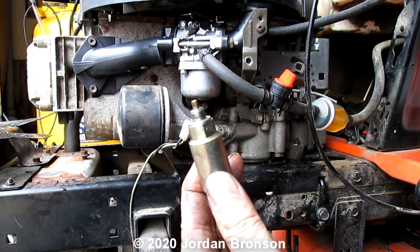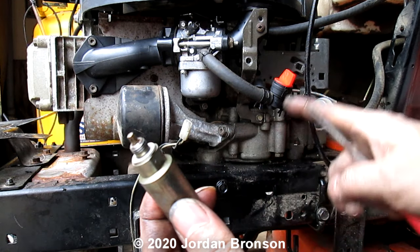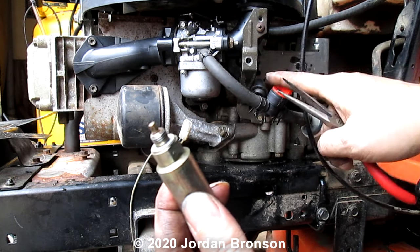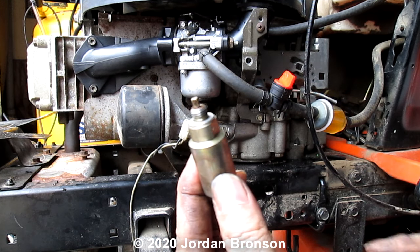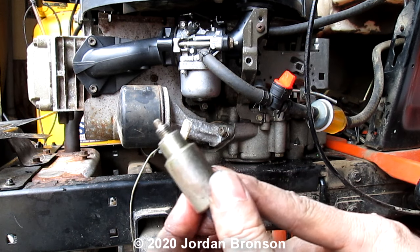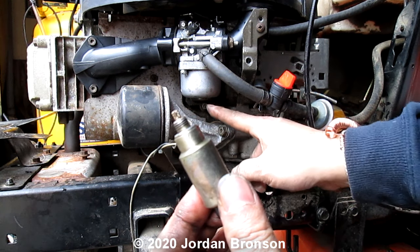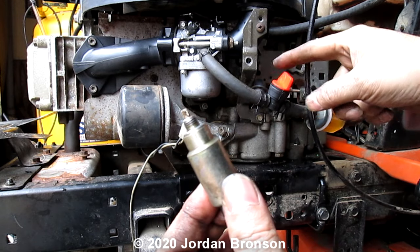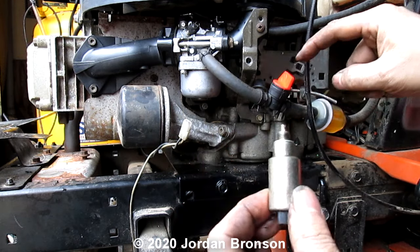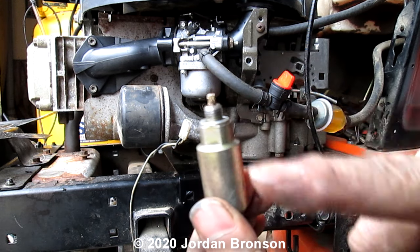And in the future, you don't have to worry about it no more. At least you know how to diagnose without this thing. At least you know if there's something clogging here or the carburetor needs to be cleaned, whatever. But like I said, many people actually bypass this. It's the most problematic I have seen. And you see that little drip right there? It's because there's some gas in here still. So we know that this might need to be replaced, or it just has to drip out the rest of it. But you don't have to buy anything extra.